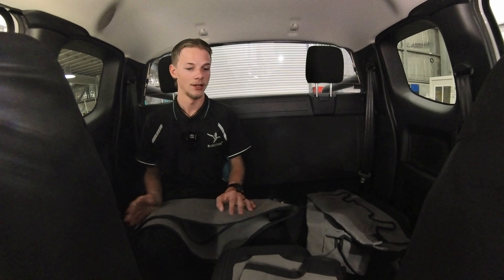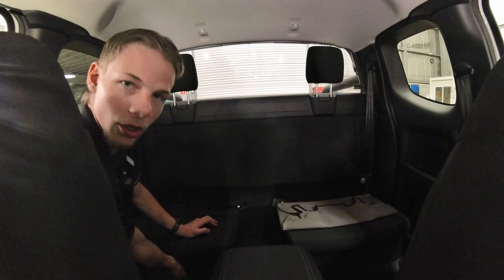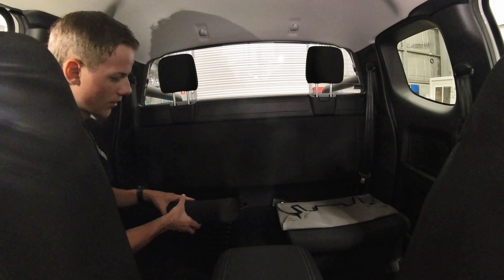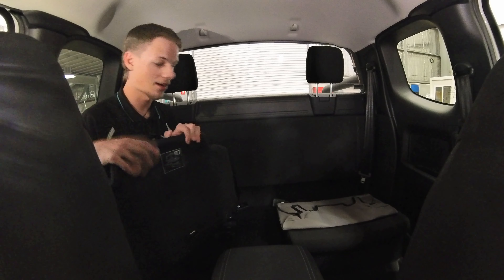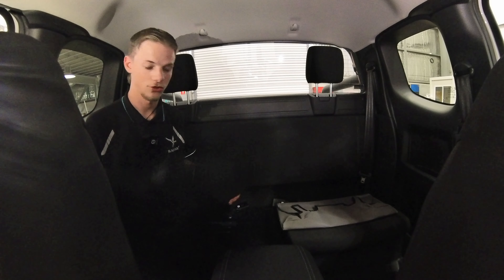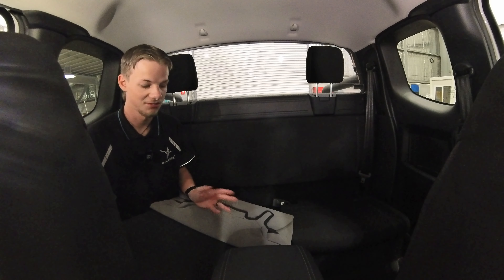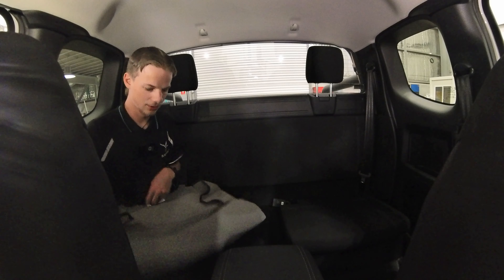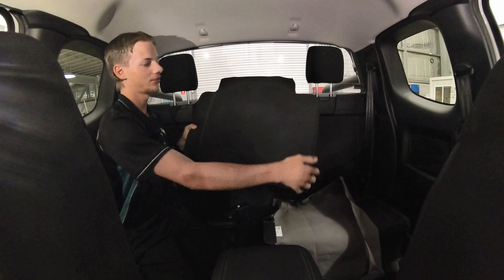With the bases, the base shape is the exact same on either side, so you don't have to worry about which one goes where. Ford have really thought this out. If you pull the tab below — there's a little lever — you pull that, lift the front up, and push the back backwards and the whole seat itself comes off. It's just an easy way to access everything without damaging your seats.